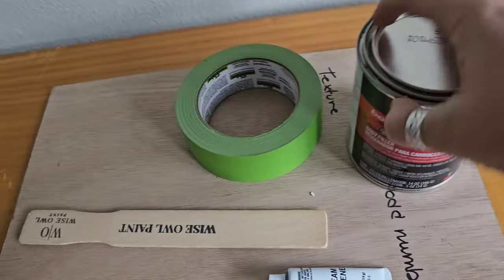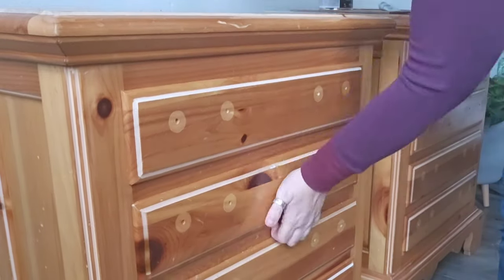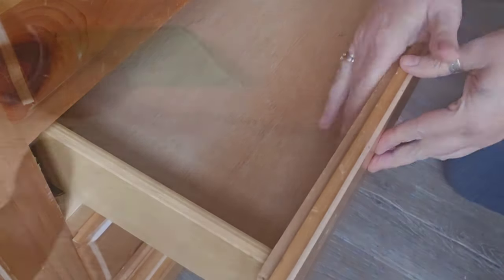You're going to need to pick up some hardening cream with the bondo, some tape, and a stir stick so that we can fill these holes. I always start by putting some painter's tape on the back of the holes so it doesn't overfill and it'll give it a very nice flush look.